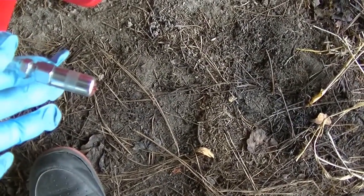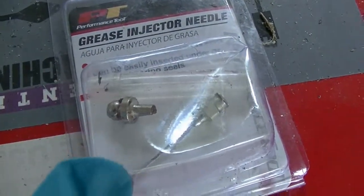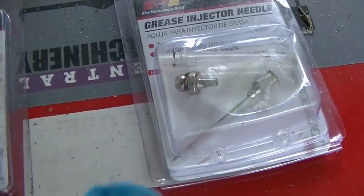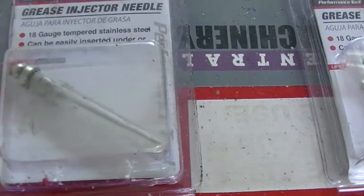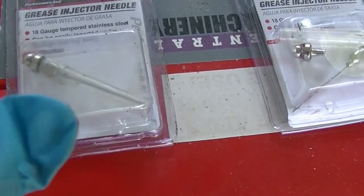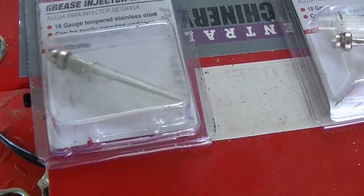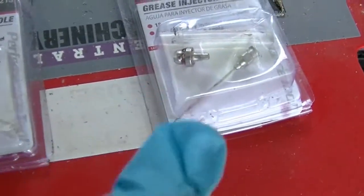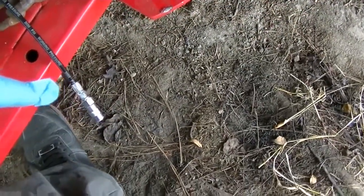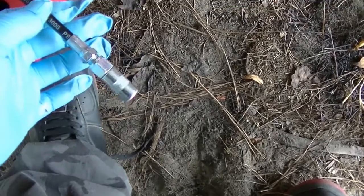What I noticed is when you put grease in here, the grease gun is going to hold on to that fitting like a death grip — it's never going to want to let go. That's how this one ended up getting broken. I've taken it back to Advance Auto so many times they don't even want to see me anymore. The only way you can release it is to unscrew this piece right here — that releases pressure from the hose and then you're able to get it out.